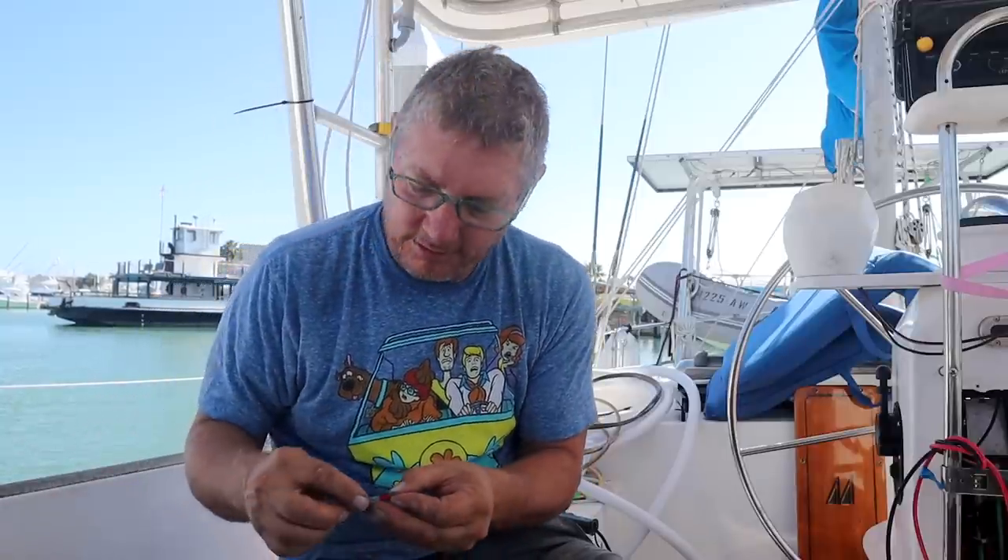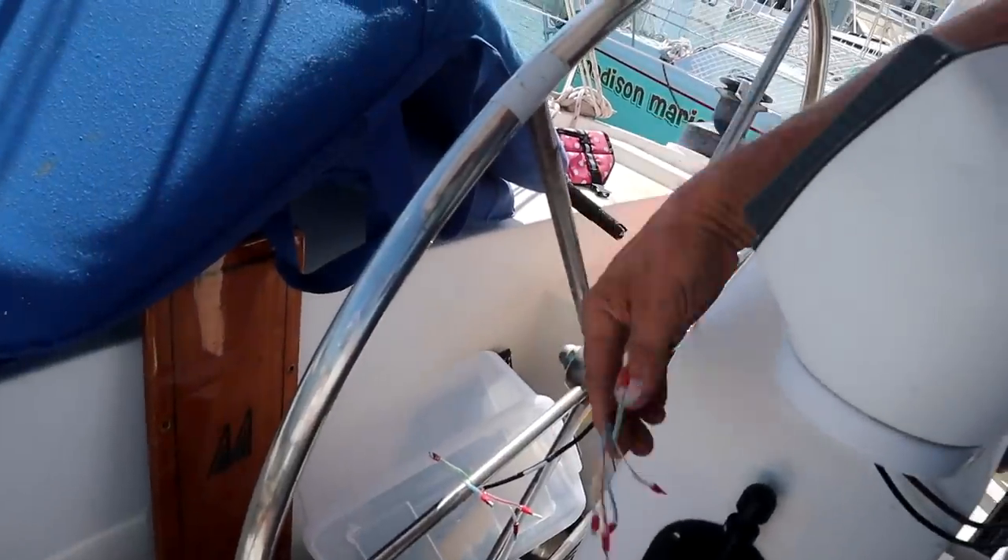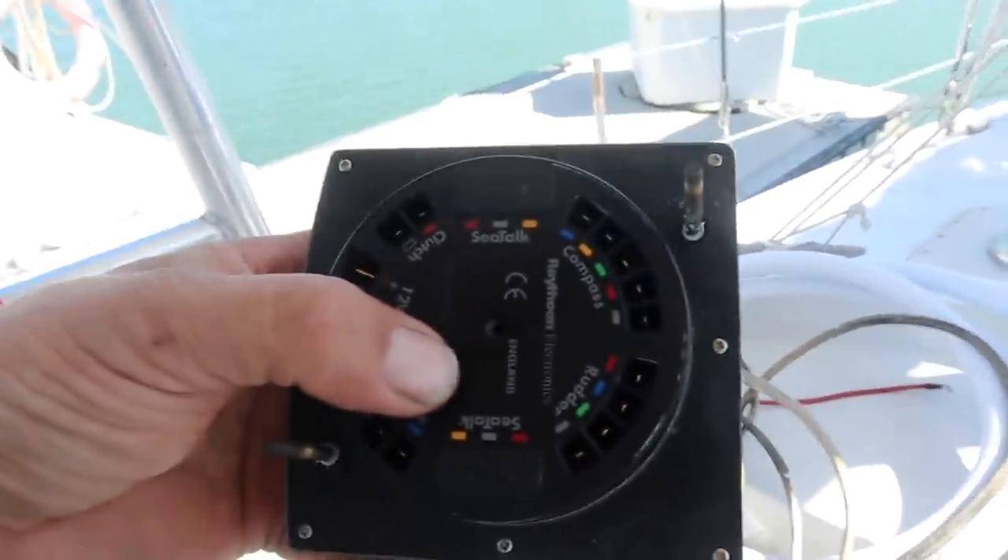That seems like it's going to work. I got the compass wires and the rudder wires, and they are all going to have to plug in right here. From the drive back to the back of the boat to the hydraulic pump is all 8-gauge wire, and you can't get a connector in that 0.110-wide pin that will fit 8-gauge wire. So what I did was bring it into a terminal block right here — 8-gauge goes back to the rudder from there, and from that terminal block up to the autopilot it will be 10-gauge wire.